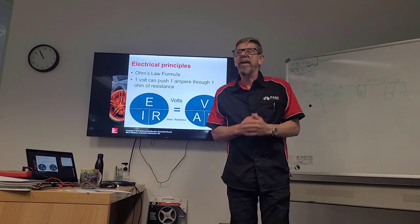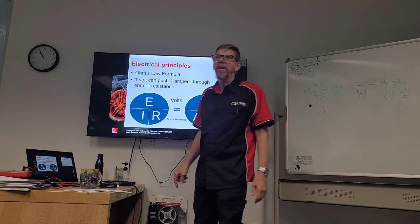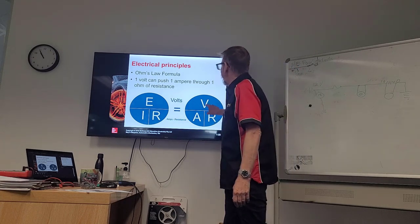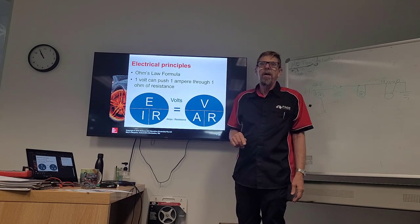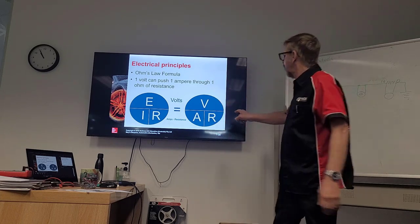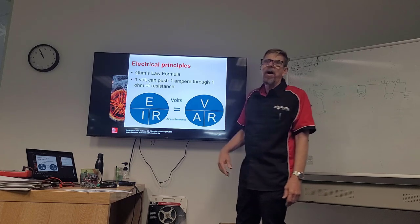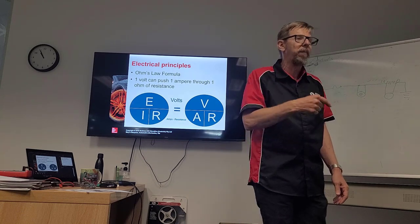Ohm's law again, okay? Here's a symbol for Ohm's law. Often we'll see E, I, R in a circle with a T, with the E on top of the T, right? E stands for voltage, I stands for amperage, and R stands for resistance. Why they use E and I is beyond my comprehension, but for me, if I call it VAR, at least I understand voltage, amps, and resistance. What that means is, if we know the voltage and the resistance, we can work out the amps as we did before, okay?